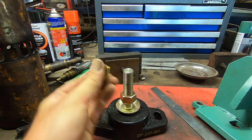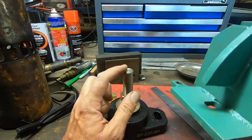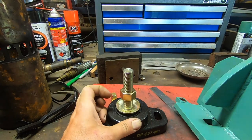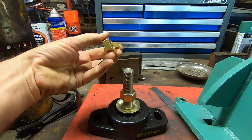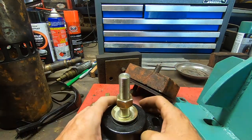The idea with these is you take your top two nuts off, then you slide it through your bracket. I'm going to have to expand the hole in the bracket because this is 18mm - previously I think 16mm or even less. Then you can adjust this nut to move the corner up and down to get your drive shaft alignment, then put the two locking nuts on the top and you're in business. The advantage is obviously you can adjust it, which was my primary concern.